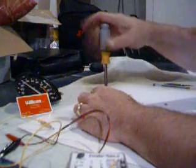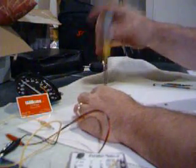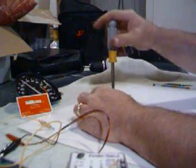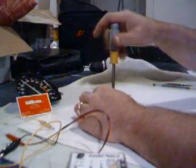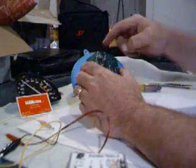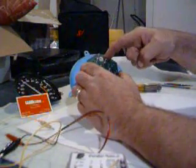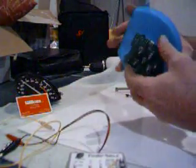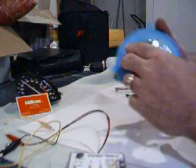There's always a possibility that a board might get damaged in shipment. There's an adjustable potentiometer on the side of the board that adjusts the signal, and there's a chance it could get hit while being installed. If you don't think the board's right, it's always smart to pre-test it before installing. You can run 12 volts to the power stud, a signal wire from your distributor to the signal stud, and a ground to the ground stud. Put a dwell meter on it, check what it's reading, and if it's off, use that potentiometer to dial it in a little bit one way or the other.